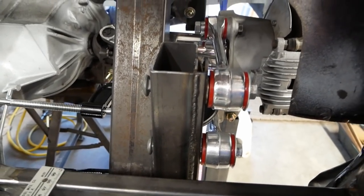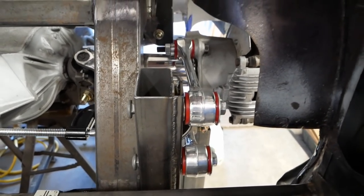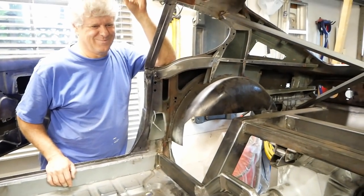Obviously this is rough, but we thought we'd aim a bit on the low side, as worst case, the car will squat a small amount rather than lifting under acceleration, which would be pretty weird. We'll need to weld in some sleeves, and although these galvanized lag bolts are a very cost-effective solution, we will replace them with some automotive-grade hardware shortly.